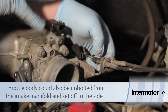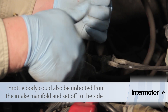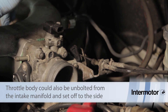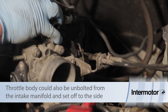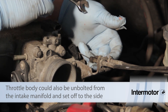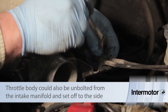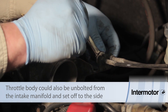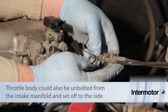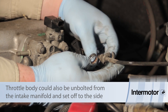All the vacuum lines are off, along with a couple of coolant lines underneath the throttle body, which have been pinched off and set aside. All the studs and bolts are removed so everything is loose. We've got a cable for the cruise control and one for the actual throttle pedal. There's a lock nut and on the front side an additional nut, so we're going to loosen the one on the front side. There's a bare spot in the housing that will allow us to get those out of the holder.